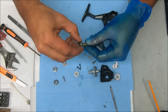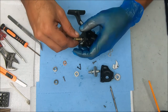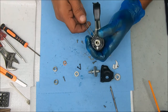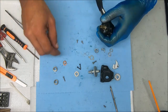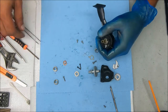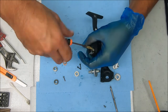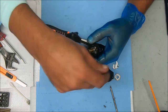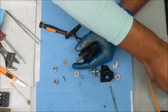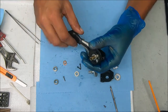Let's go ahead and get our bearing put back on there, looking just like so. I'm going to drop that in place, make sure it goes down through that hole inside there, and make sure this sits flush. Now we can stick our washers on there so we don't forget them, but we need to secure this with these two screws — one goes there, one goes here. Now while I'm here I'm going to oil inside this point right here, just for the arm. Work that in, and that's it. I'm going to leave that in the open position.